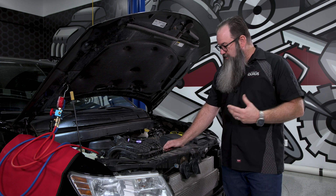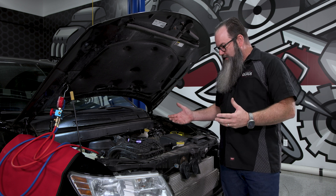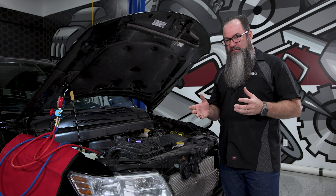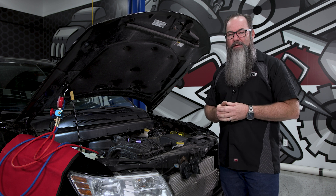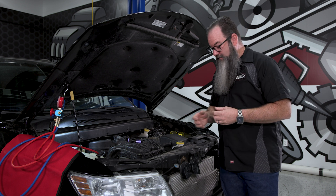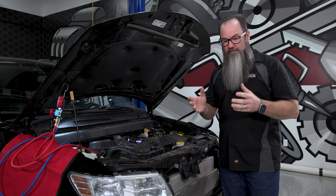At this point we want to evaluate the system again and start looking around to see what we can find. Since we already injected dye, we know we can go straight to the black light. A couple of things I want to warn you about: oil leaks sometimes will show up bright underneath the black light — some oils have additives that really give it that UV shine. Power steering fluid can do the same thing. So if you've got a valve cover gasket leaking a little bit and it's dripping down on top of the AC compressor, that could be misinterpreted if you just look at the AC compressor and see that shine. So always look up above, look for an oil leak, and make sure there are no other problems.